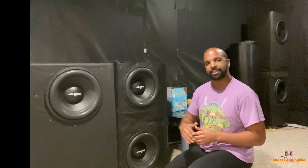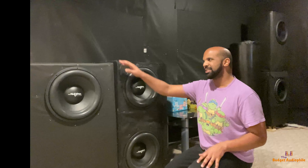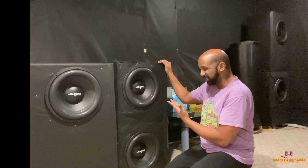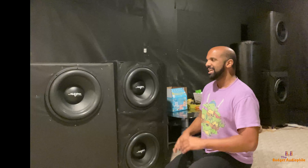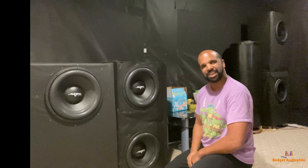You can see we've got a two-in-one configuration. I thought about adding another sub down here just to see what that would sound like, but this enclosure is only 5.8 cubic feet, whereas this one is 8.5 cubic feet — so each sub gets 4.25 cubic feet to play with. The smaller one would only equate to just under 3 cubic feet for each sub. While that may model well, I think I'm just going to leave that guy by itself — it plays really well in there. Those bombs exploding in 1917 were really set off by this trio right here.